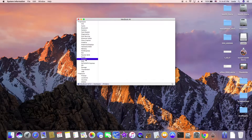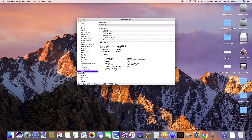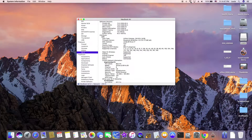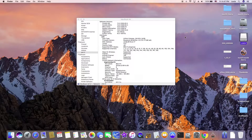Printer: we use the wireless AirPrint and it's already there — J485DW. And USB — all of them are there. The Wi-Fi DW1560 is a must-buy because it supports both 2.4GHz and 5GHz, and Bluetooth 4.0 is actually working with AirDrop.